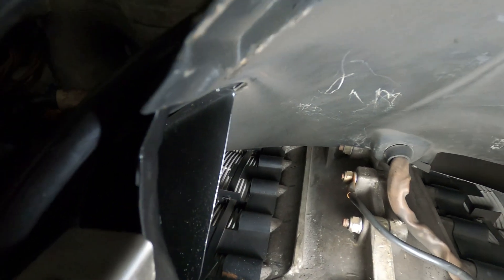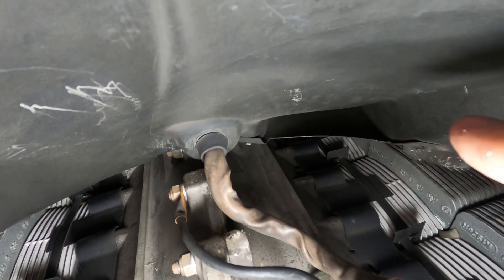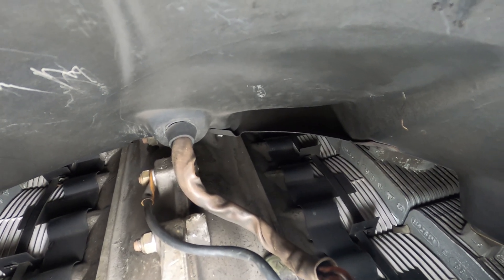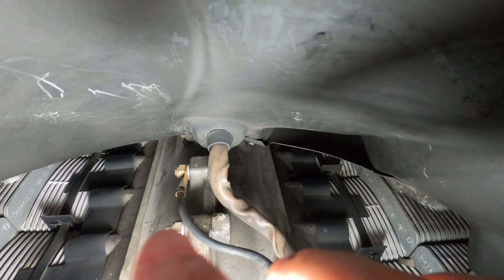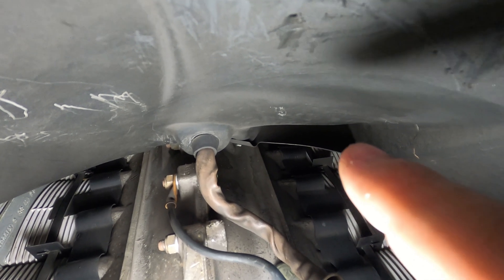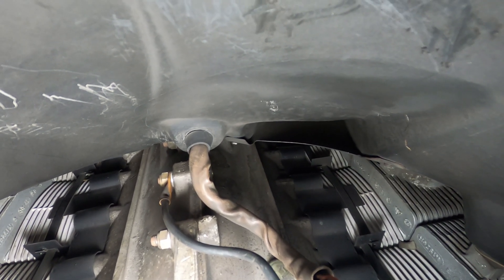Back this way is the first oil cooler. This car has two oil coolers, and pressurized air goes through a duct over here to another oil cooler that's on the back side of the engine on the passenger side — which is technically the front of the engine. That's thermostatically controlled. When you warm up the car this is your primary cooling, and when the first thermostat opens — there's a thermostat as part of the case — air is always going through, but no oil will be in the cooler until the thermostat opens. So it's like a two-stage system.